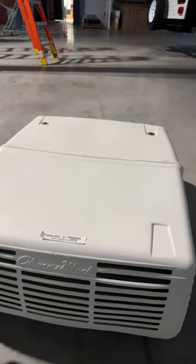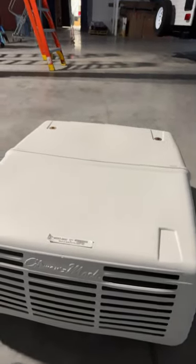That is on the interior of the coach technically, but inside the air conditioner. From my experience, a lot of DIYers aren't very comfortable with the part about getting on the roof and removing the shroud. Cleaning the condenser — the back of the air conditioner — is the most important one outside of the filters that are inside the coach on the air conditioner shroud. Even if you don't do it yourself, just make sure you put it on the list of things that you're going to do when you bring your RV in for yearly maintenance.